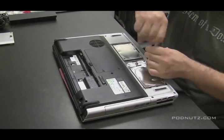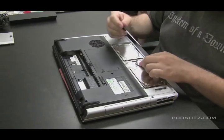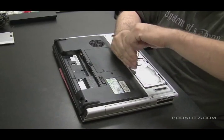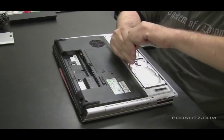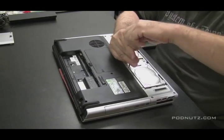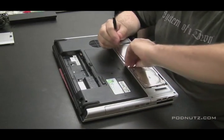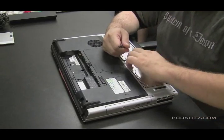The iced tea actually got down through the computer to the bottom of the hard drive — it made it through the system. So I don't even turn the computer on until I check if the motherboard's okay. If there's any liquid spilled on the computer, I never turn it on. I pull the battery out immediately, don't hook up the AC adapter, don't even test it. I just take it apart and inspect the motherboard as first priority.